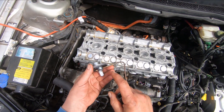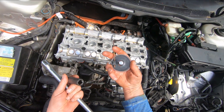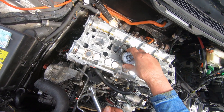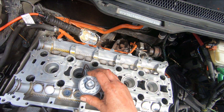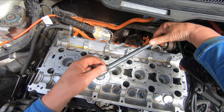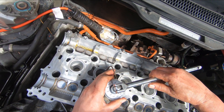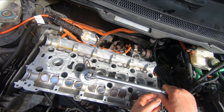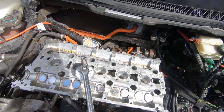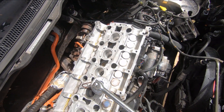I just made up a little piece of wire and put a screw in here to hold it steady. Got my socket on there — it's got a half-inch square drive. You can see how that bar is going to hit up against that spark plug well. We've got the dial set back to zero, and we're going for 130 degrees. Zero that dial again first — okay, zeroed. Now we're going around: that's 90... 115... there's 130. Then we go to the next head bolt in sequence.